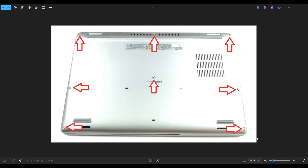You have a total of eight screws on this bottom case. After taking all of those screws out, you're going to take a small, flat, preferably plastic pry tool — I say plastic because it should scratch your case a lot less than a metal one will. You're going to go around the seam of the bottom case and pry it off from the rest of your computer.